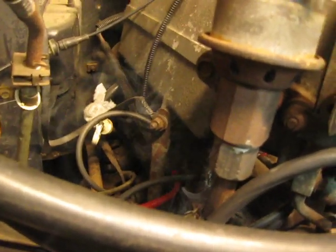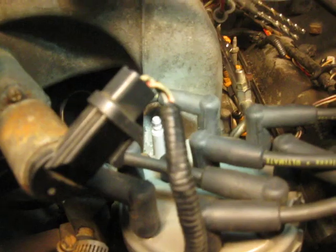Well, it's definitely the EGR at that point. I might do this again — plug off the EGR to see if I can get it to come out anywhere else, just to double-check if I might have a leak. I was really concerned about the intake manifold. I'm not seeing anything down there.